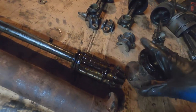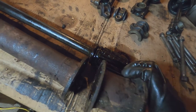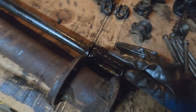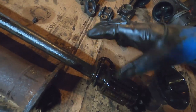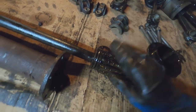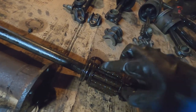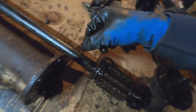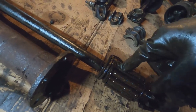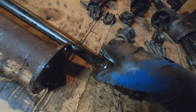On the other side you have the bearings. There is a bearing housed on the inside of this piece — this drive shaft lines up on the inside of it, and this piece provides the outside surface for the roller bearing. So you have the roller bearing and then a ball bearing for a thrust surface on the inside. Both of those together are the bearing package for this car and they seem to be in good shape. I'm going to clean the gunky oil off of them. You can't take these off without taking off the gear because the shaft is only machined on the end, so the diameter is a tiny bit bigger and these won't come off. So I don't have to take them off — I'm going to clean them up as-is and leave them there.